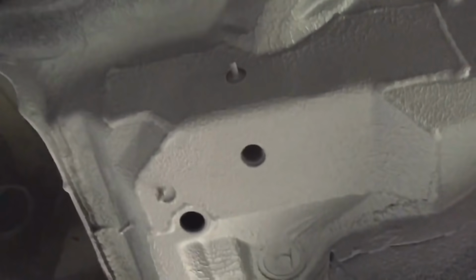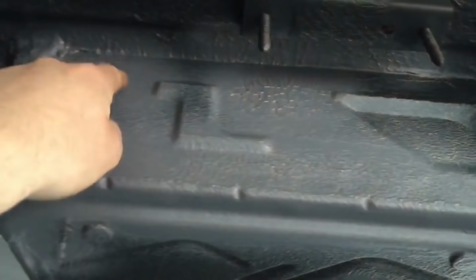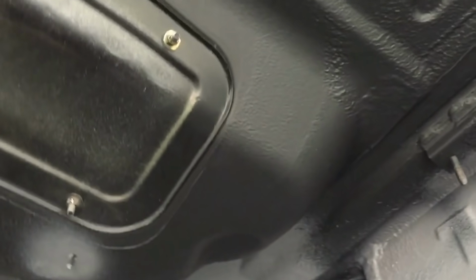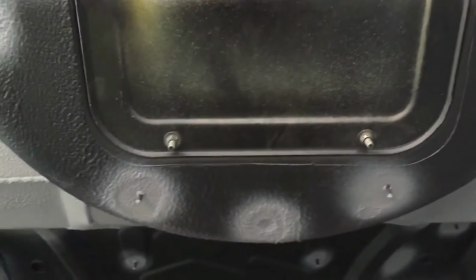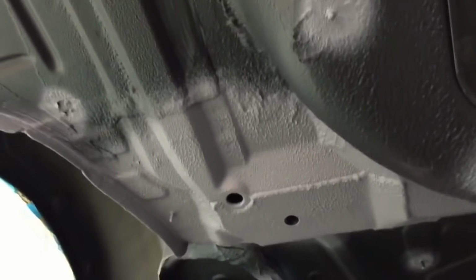That's turning around to the right rear plate. These are our reinforcement plates. Then we go over to the battery tray area where we remove this redundant bracket which the non-Ms have. So all the way along there, which is a big collection point of rust, and up there we've blended some new seam sealer into those edges. And then on the areas we've removed around mounting studs.